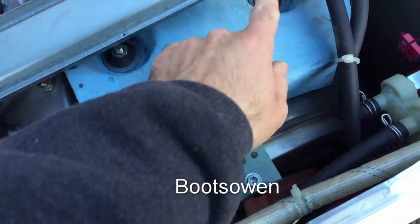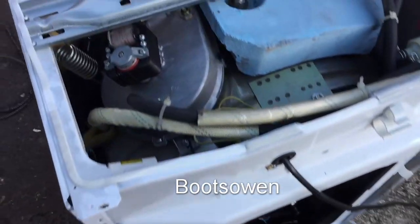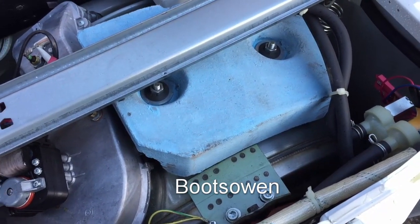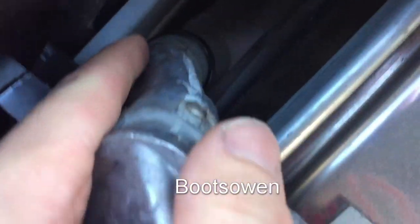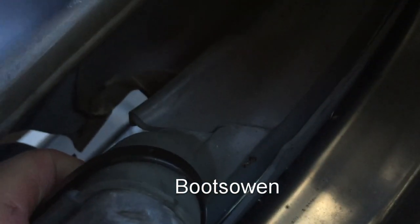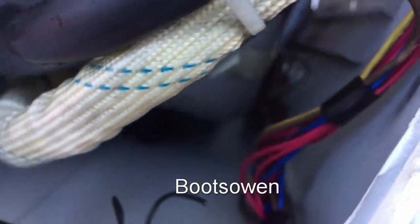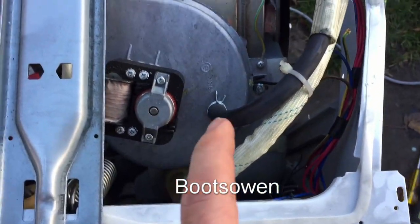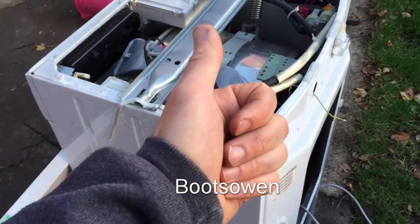So the last thing for me to do is to get this blue ballast off — I don't know if that will make any difference really, but with the ballast gone it might vibrate more, it'll have less dampening. The more I look at this, the more broken it is — you see that daylight in there? The rubber door seal's knackered, you can get your fingers in there, that whole door seal's completely dead. And the other thing was the suppressor — whenever I was taking the suppressor out just for keeping for bits, the top was blown off it. So brushes, rubber door seal — the whole thing is knackered. This machine? Bricks is all it's fit for. Thanks for watching, see you later.